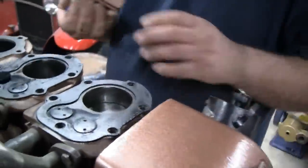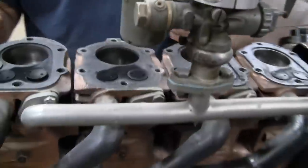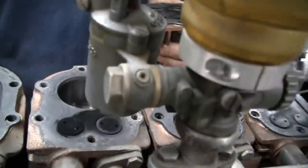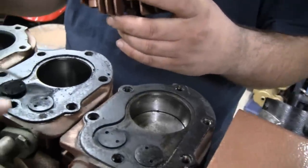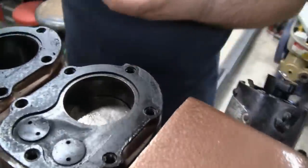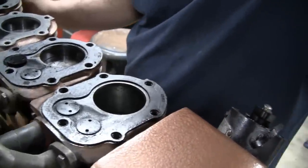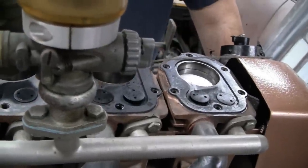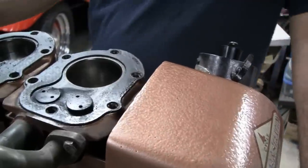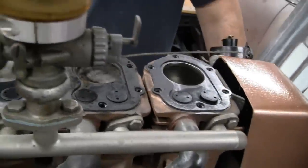Got all the heads loose now. This is what happens when you run it like we do right, Mike — carbon builds up because we really don't blast this thing. Nobody wants to hear it scream. For that reason, the pistons never swell up in their bores and they don't really seal all that well, so it always pumps a little bit of oil. Just one cylinder here — I think that's maybe our problem cylinder, every once in a while it spits. The cylinder walls are a mirror finish, so it's polished. It's gonna pump some oil, but hey, it's an old engine.